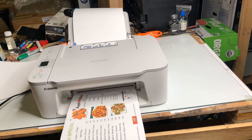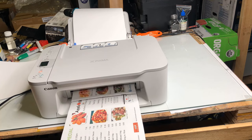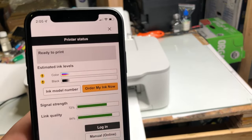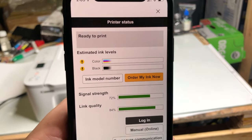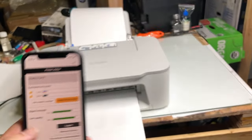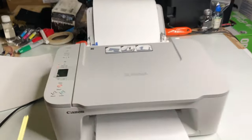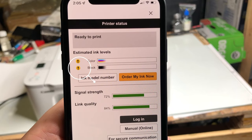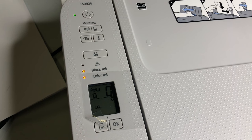Your starter cartridge can print about 50 to 60 pages. However, Canon doesn't have any sensors that can measure how much ink is in the cartridge. How does Canon know how much ink is in the cartridge? If you printed 40 pages and Canon says you're low on ink, it seems pretty accurate. The answer is simple - Canon just counts how many pages you printed. If they have a preset value of 50 and you print 40 pages, it will say low ink, you only have 20% left. It shows this low ink warning, which is a steady amber light. You can see the light is not blinking at all. Other than the amber light, you can see an exclamation mark next to your ink level on the ink monitor. I'll show you how to turn off the ink monitoring later in this video.